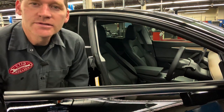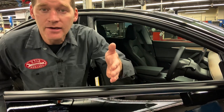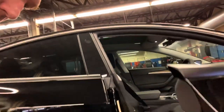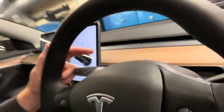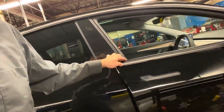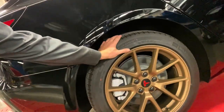The first thing is it's difficult to get the car into neutral. We need to fool the car into thinking someone's in it — if it thinks you've gotten out, it'll put the parking brake on and park. So we want it to think the door is shut; you could use anything, I have a pencil. Okay, it thinks the door is shut, seat belt is on. The car's in neutral now — we just can't touch the door handle because it'll unlatch, so we'll carefully swing the door and let it sit there. We are in neutral and we can roll the car.